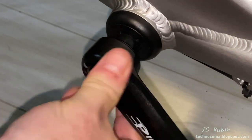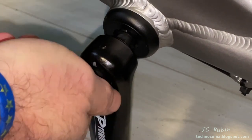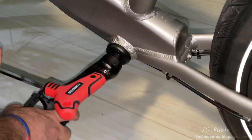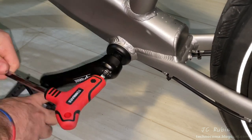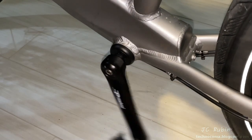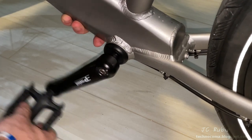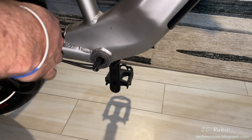I match the crank up to the previous surface, lay it there, insert the screw back in finger-tight, then tighten it all the way down to get the crank back into full seat. There's obvious resistance as it tightens, coming to a dead stop — that's where I don't go any further. I give it a spin — crank feels good, no slop. Pull in every direction and I don't feel any deflection, so things are looking okay. Repeating the same process on the other side.